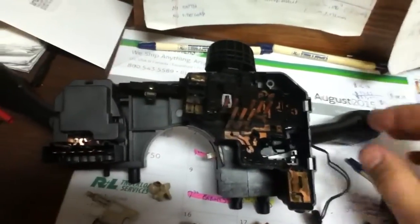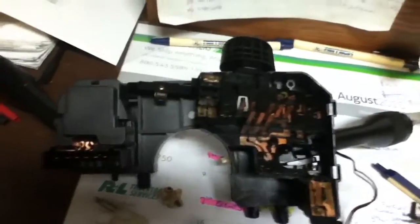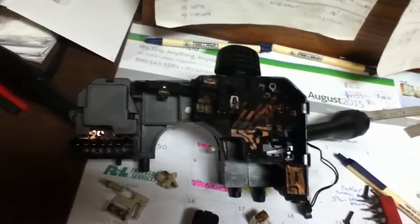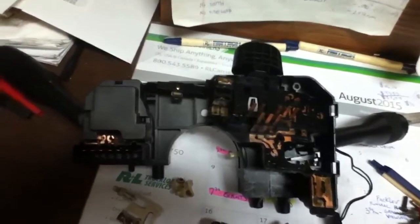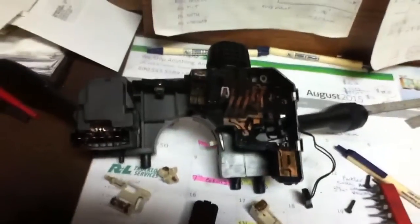These units might be around $75 to $100 from a parts store. The junkyard only cost me $14. I like pulling my own parts — it's sort of like recycling. If you need to buy one, always look for coupon codes on RetailMeNot for Advance Auto. Good luck — don't just yank your fog lights out to pass inspection. It could be the switch, and it's a simple fix you can do yourself. There are just two Phillips screws holding the shroud on.